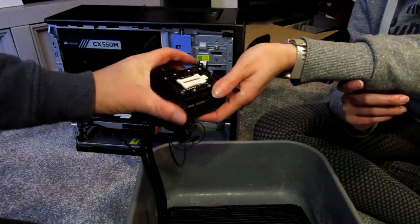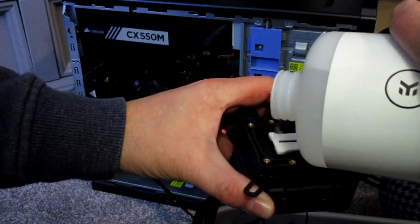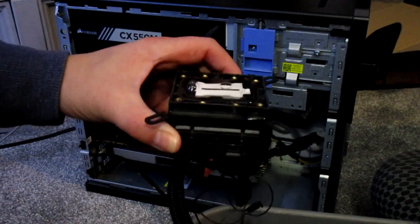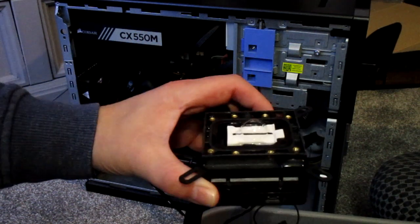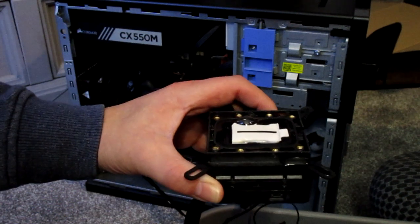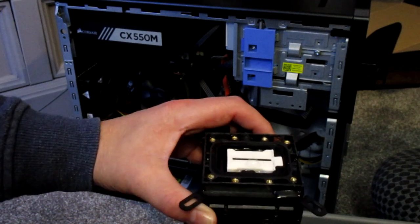So I'll show you — I pour my water in like so. Don't need much, just enough to fill up the area where the gasket is. Then I'm literally getting the rad and tipping it up like that — you can hear it going in. Then you literally just put it back down flat, and then do the same again. You can see there's bubbles coming out already. Just do the same again — and there we go. I just sort of worked this out filling it up myself, so I thought it'd be a little tip for anyone who tries doing this.